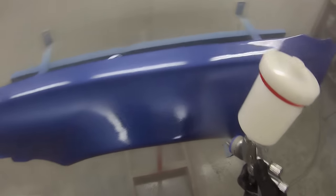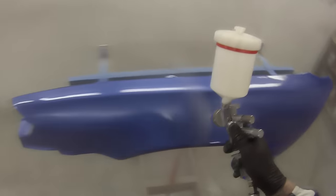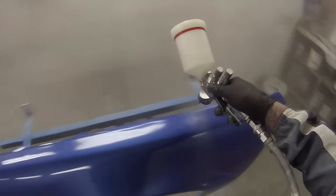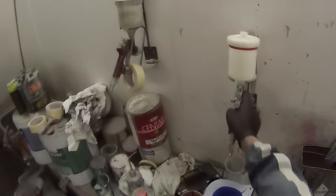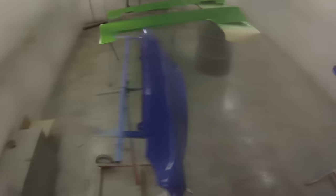Just back to heating your clear up — as you saw, we heated it in hot water. Be extremely careful: you don't want any water getting into the clear. Water will rise to the top, so just get a rag and sit it on top to soak up any drops. Water in your clear is probably one of the worst things — and humidity is another very bad thing when painting. If you've got high humidity, be very careful. Here in Perth we mostly get dry, hot weather, so it's not a big issue.